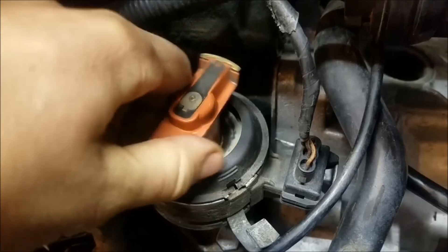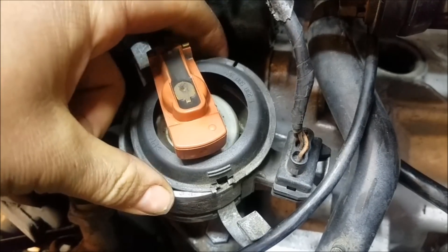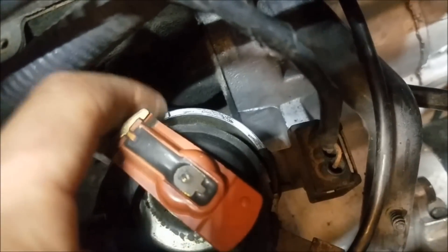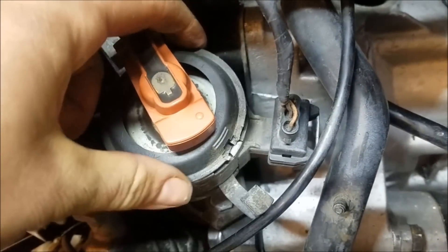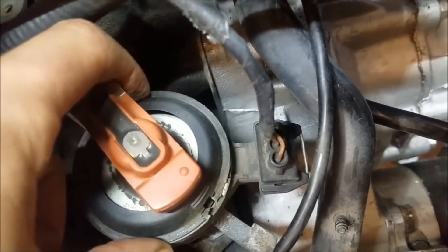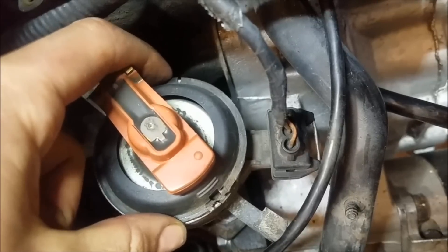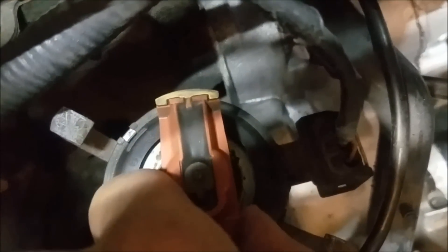What's also really cool, and a good way to double-check if you've set your distributor timing properly: on the plastic there's a little cutout, and that corresponds to a notch on the actual distributor housing itself. You'll see how there are little tabs where it sits, where the clips go. Even if you don't have this plastic, the notch is actually on the distributor. I don't know if all ABAs have this, but mine does — so it's a great way to double-check that I did my distributor timing correctly.